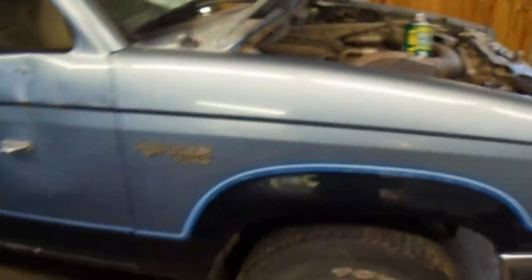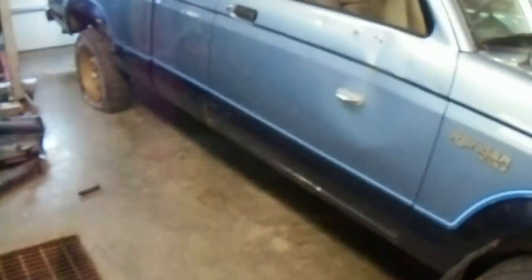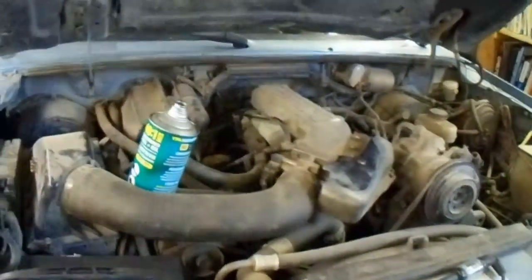So I got it in the garage and Kayla and I spent a night going through it and checking things out. The very first thing I do mechanically is go through and check all the fluids — this being a four-wheel drive it's got a front differential obviously. We check everywhere in the vehicle, look for any contamination, any major leaks, and any signs of mechanical damage, since mechanical damage has the potential to be expensive and make the vehicle not worth putting back together.